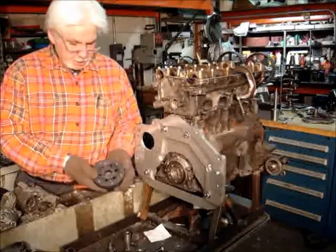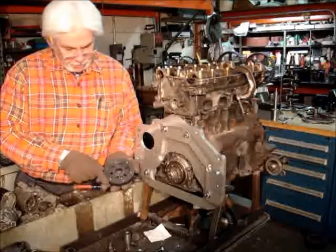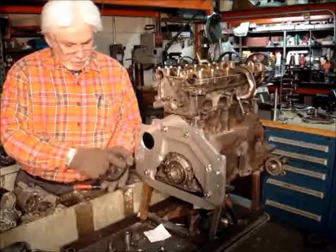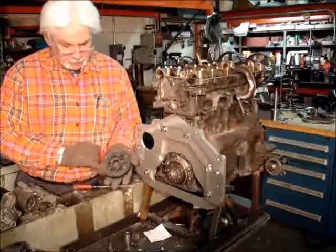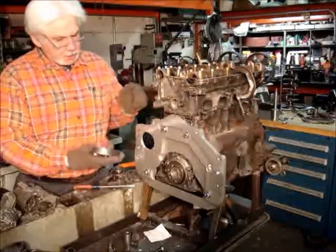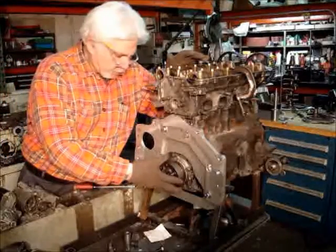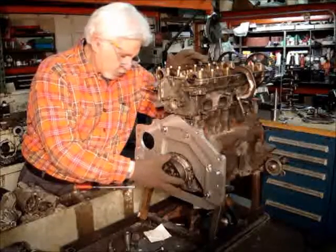And the way I did this was I built the flywheel side just like a manual transmission flywheel for the Mitsubishi, and then on the opposite side I put in the bolt pattern for the Chevrolet, and I elevated it high enough to clear the bolt heads for the Mitsubishi. Originally I made these too tight, and with experience I learned to make them a little looser. So they're within a thousandth.